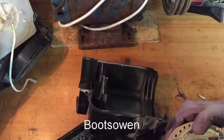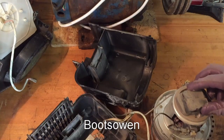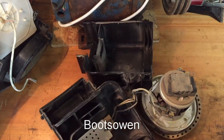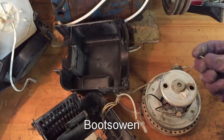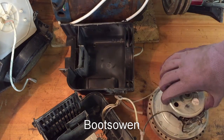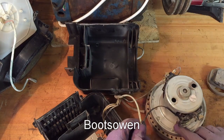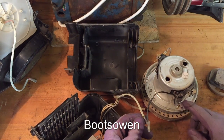So there's the motor. It just has a brush on each end, with a rubber bushing mount on the back. There's a heat sink in there for what looks like a Triac or something — a motor speed controller unit. I'm not sure where this piece of metal would have come from. I guess we could just apply power here and here and see what happens. There's probably a temperature sensor in there — an overheat sensor — that could be blown.